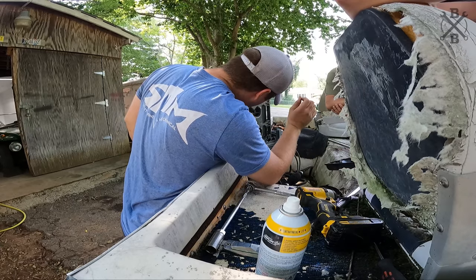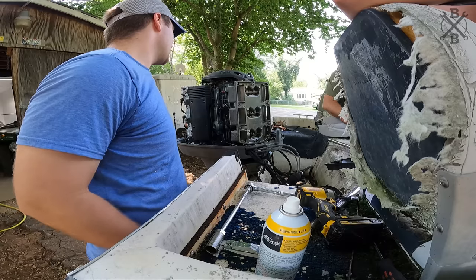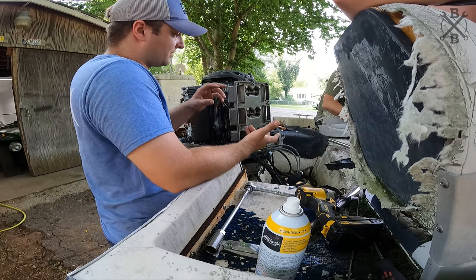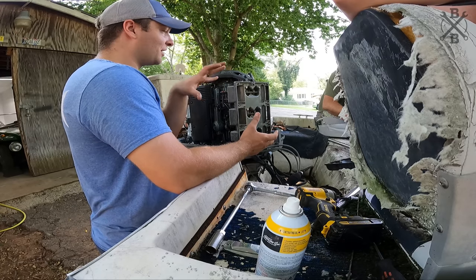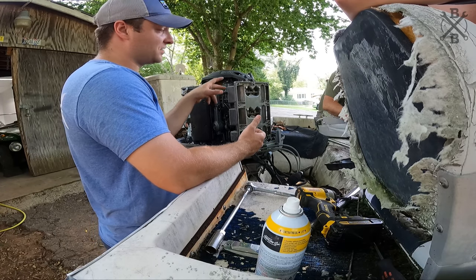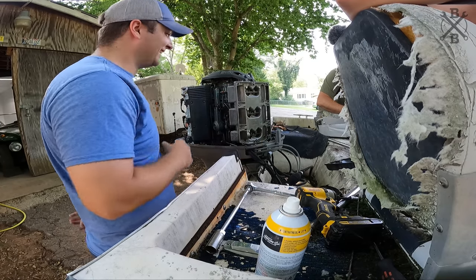Now, I will tell you what's going to be fun. What happens when these boat motors sit, because you're a two stroke and you have oil in it, your fuel will evaporate. And I can about guarantee if we pull, let's pull the drain plugs on those carburetors, straight oil is going to come out. Get some oil coming out of there.